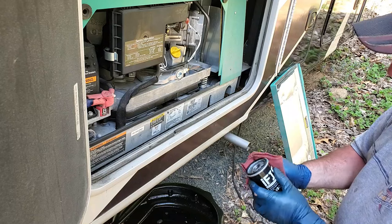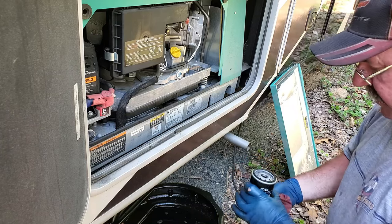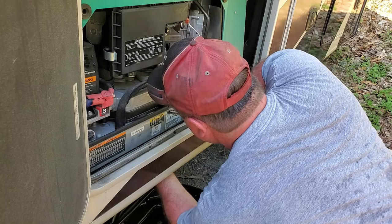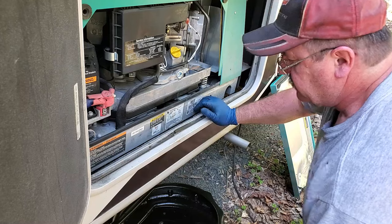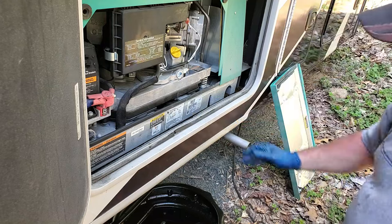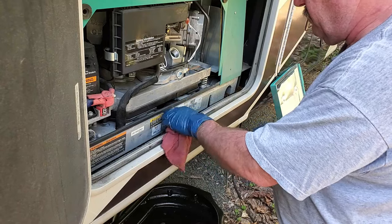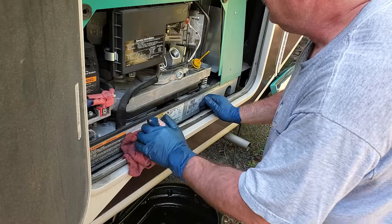Want to make sure you have something on there — usually there's going to be oil on the underside. I'll put oil on the ring, on the gasket. You need to do that after you reach up in there and clean the oil off the housing inside. Now to get this in there without getting it dirty you need to work it a little bit to get it through that grommet. When I picked out this filter shopping online, there were different sellers selling the same numbered filter, but looking at reviews a couple people said it leaked or didn't screw on easy. So make sure you do at least a little bit of homework — or you could just go right to Cummins and get theirs, it's only about thirty dollars a filter.